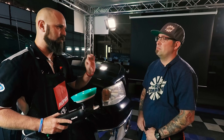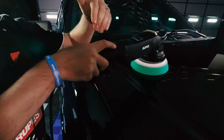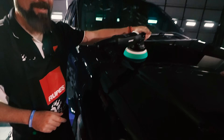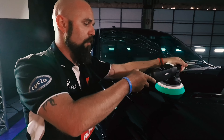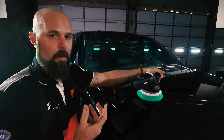I'm going to take this with our four drops and find a nice flat surface — doesn't really matter where it is, but you want somewhere flat, so the hood always works. I'm going to run this tool down to speed one, the lowest speed setting. This vehicle has 210,000 miles; we're not trying to polish the paint right now, we're just trying to prime the pad. So now that I've got it on the paint, you can do a little wiggle if you want to get started to spread around, but all I'm going to do is apply a little bit more than normal pressure to the tool and hold it in place for about a 15 to 20 second count. That friction and movement is going to get the compound spread around, but it's also going to introduce that heat we need into the pad.